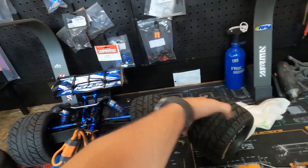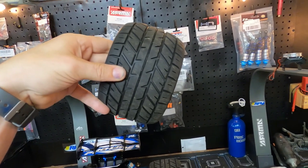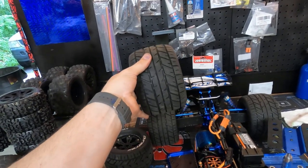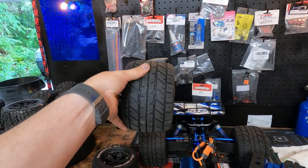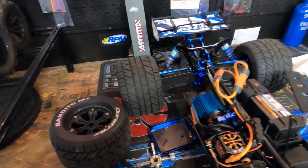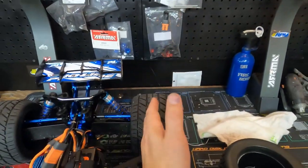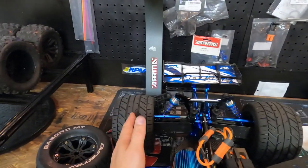Let's say you don't have much negative — you actually have positive — which means instead of the tire being straight, it's pointed outward. That's not good. I can actually see that my back tire on this side — the bottom of it is pointing outward. That's not what I want. I want that to be completely level. I'm looking for either zero degrees or one degree out of the back. I can see clear as day this back tire is straight up and down — probably at a one. This other one is more like at a positive one, so that's why it's going out.